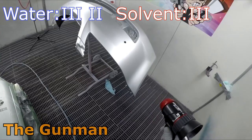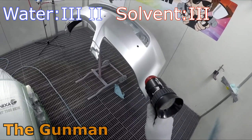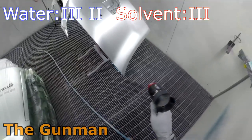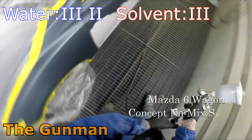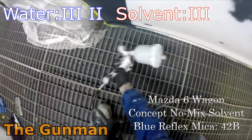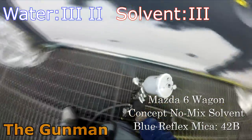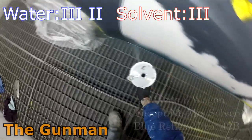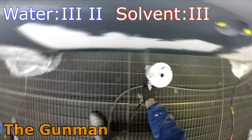Before I got these blowers that you see me using here, I was just using what we call a duck's bill. So that's basically just a piece of plastic, a yellow piece of plastic on the end of an air fitting. It's got a few holes in it and it will spread the air that comes out of the airline, so it won't actually draw in any air from the spray booth, whereas those blowers that you were seeing me using there, they will actually draw in air from the spray booth and you will have an increased airflow over the panel.